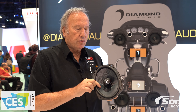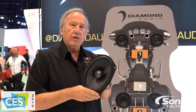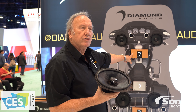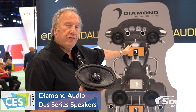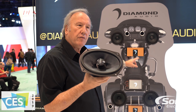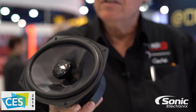It has a really cool cone, water resistant, very high power. For motorcycle use with big power, this is great. It's coming in a 4 ohm version and a 2 ohm version, because in our micro amps we make a Micro 2 V2 that is 150 watts at 4 ohms, but 225 to 250 watts into 2 ohms. So you can put 250 watts into this with a very small amplifier, making it really handy for motorcycle guys or car guys — whoever wants to use it.